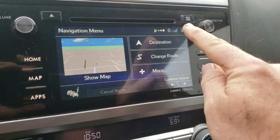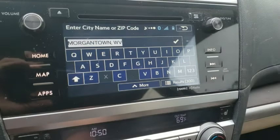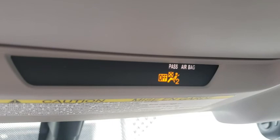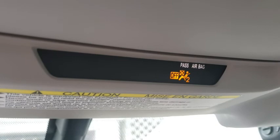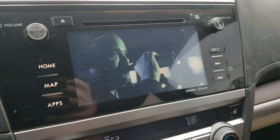Finally, we are at number five. Before this mod, we were not able to input GPS directions while driving — it would actually lock out the keyboard on the head unit. By grounding the VSS, or vehicle speed sensor wire going into the head unit, you're able to use it while driving. The car knows if there's a passenger or not. I thought about connecting it directly so that it could only be input if there is a passenger, but I didn't want to mess with the airbag, so I just took that safety out entirely. I do not encourage anyone to have distracted driving, but why a passenger can't input directions is beyond me. There's also the side effect of being able to watch videos while driving — I do not encourage that either.